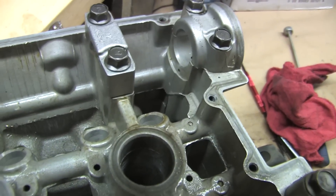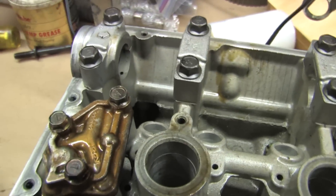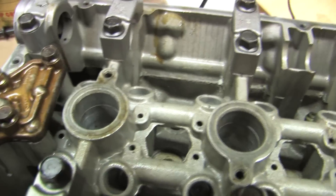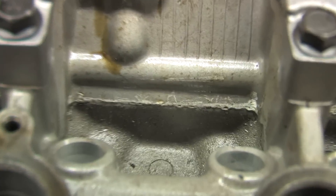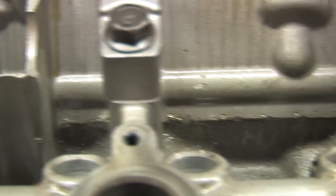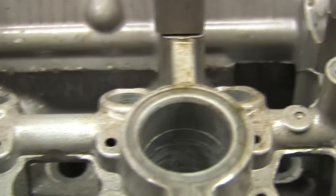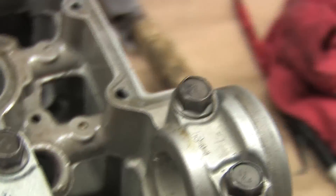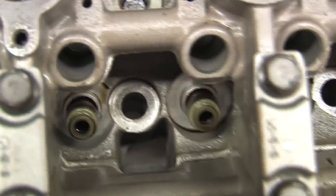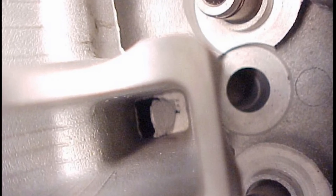Here's mine after I worked on it. What I did was I actually sat here with a hammer and a punch and knocked off all the loosest of the casting. I didn't want to take a whole lot out — just what was weak. You can see back here on this back edge some of my pecker tracks where I knocked all that stuff out. One of the oil galleries was blocked — it had a huge flake of aluminum sitting up where the two pieces of the mold came together, nearly completely obstructing it.